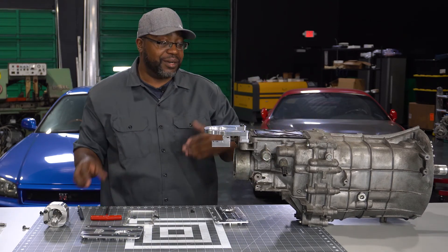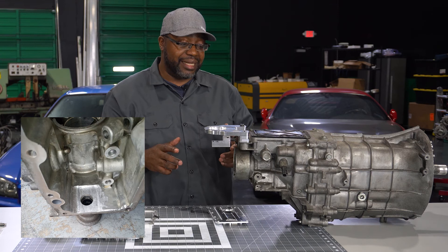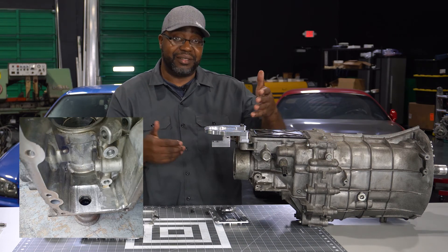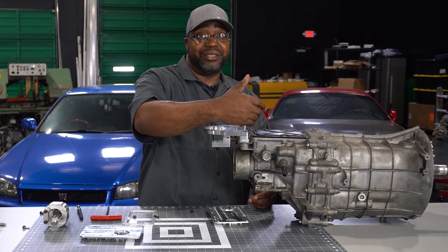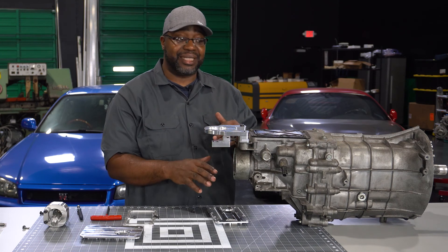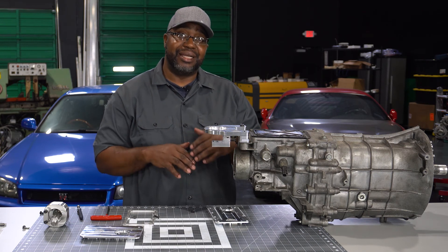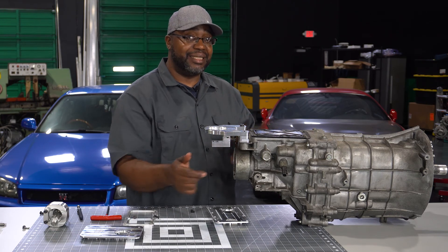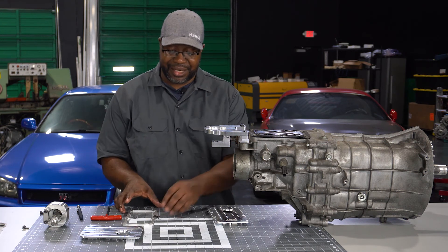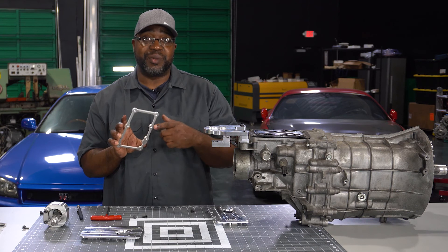For the front mount shifter, there's also a picture on the item's description showing clearance on the back side of the case. Doing that will eliminate any possibility of the shifter popping out of gear due to interference, harmonics, or vibration. The shaft coupler is really close to the back side, and there are about four different tail case castings — so regardless of which tail case you have, do that mod to save yourself time and trouble. Those two mods will solve about 95% of your problems. The only other issue is usually related to the spacer, which I've already covered.